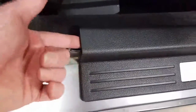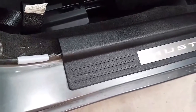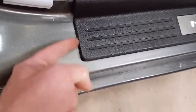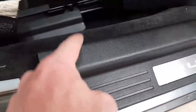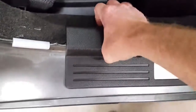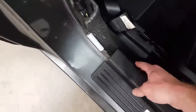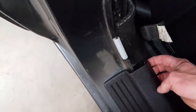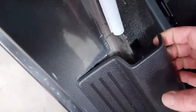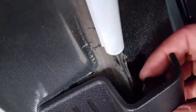In order to remove the trim panel here, we do need to pull up the sill plates a little bit. I've got the brushed aluminum illuminated sill plates — I think that's because it's a premium. I believe they're adhesive taped down here and held in with your standard pull-them-up pop-out clips right along here. So what you do is slowly start to work it up like a half a click all the way up. Once you do that, you'll be able to work this up enough without messing up the tape underneath, and you'll be able to get this trim piece out — there's that little pin that needs to become disengaged.